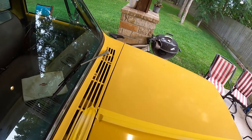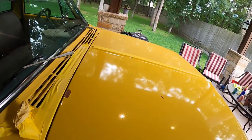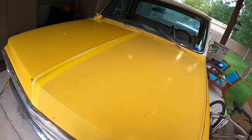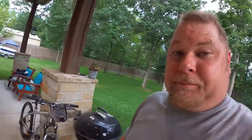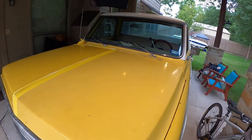Here you can see the before on the driver's side of the truck, and then you can see the after. Especially from this point of view it's very, very clear that there's a difference — and that's just steps one and two, the clay bar and then the compound. It's a world of difference. Look how much deeper that side is than this side — it really, really makes a difference. There's still a lot more to be done, so I'm going to do steps one and two over the entire truck, then come back in another episode and show you steps three and four, which is a cleaner wax followed by a good polish wax. I'm really, really happy — a lot more to do, but I'm glad to be getting it started. The interior is getting better, the exterior is starting to get better, and the truck's just going to look better and better as we go, then we'll start working on the mechanicals.